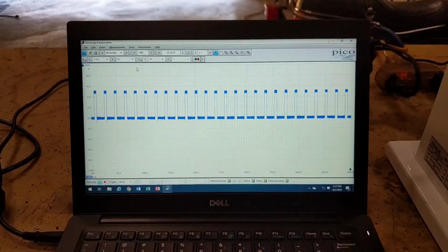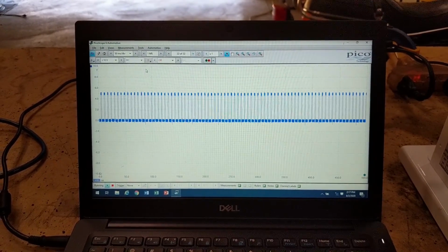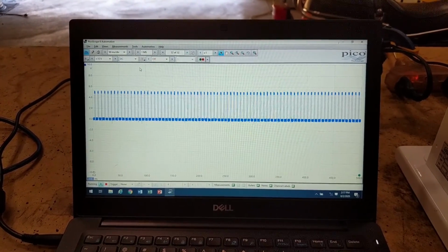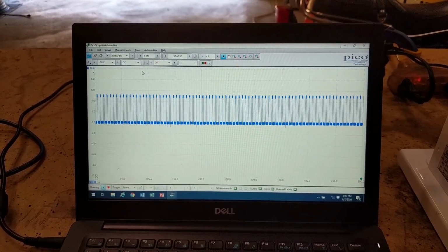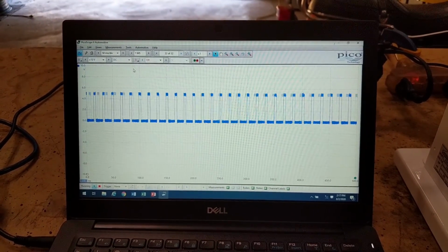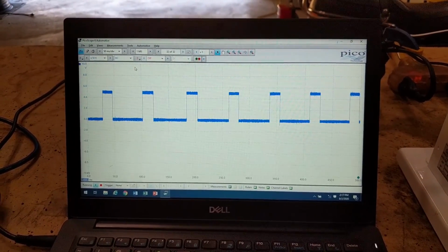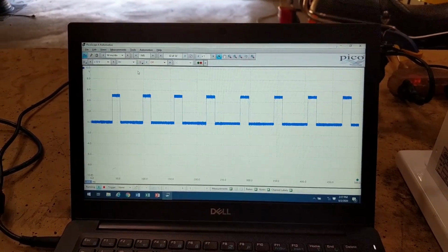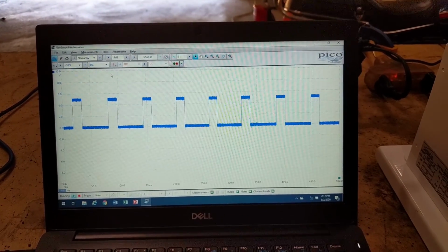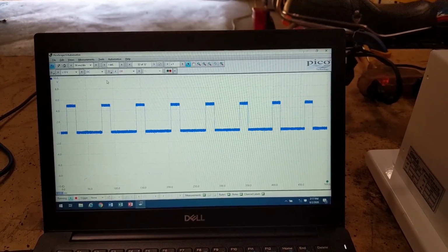With an active sensor, the frequency can increase, and it doesn't go above 5 volts or below 0 volts. So this is a DC voltage, 0 to 5 reference, 0 volts to 5 volts square wave pattern, and it's a lot more accurate and easier for a control unit to interpret the data coming in from a sensor like this. Depending on the application will depend on what type of sensor is being used. And in this case, this is a Hall effect 3-wire sensor, 5-volt reference, signal, and ground circuit going to and from the sensor.